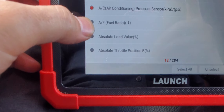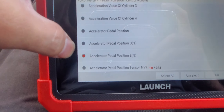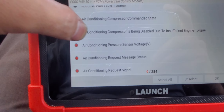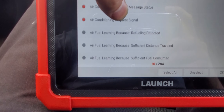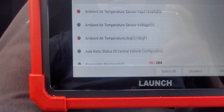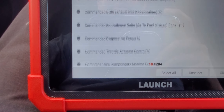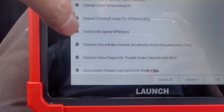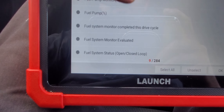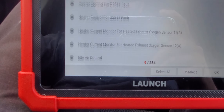The air conditioning command state is on because I have it switched on. I'll put it off so it's off. I can also pull up a data stream at the same time — let's go to data stream and select all the parameters that apply to AC: air conditioning pressure sensor, air conditioning request signal, air conditioning temperature. I think that's about it.